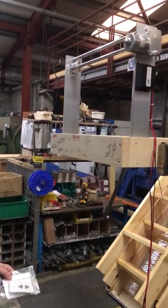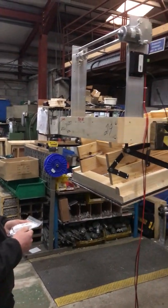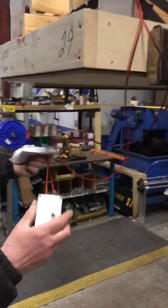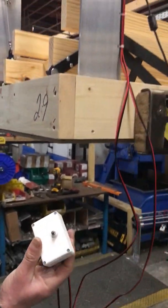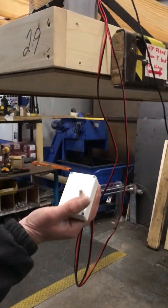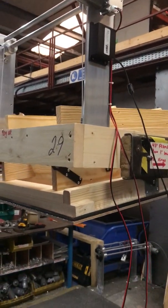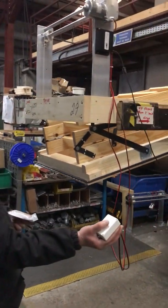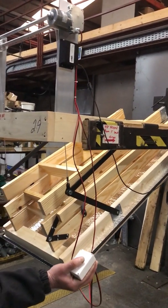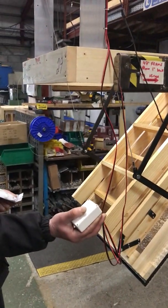And then one other thing we're just going to show you is the emergency hatch release button. So this is if you have a power cut or something in the house, which is this button here. It's normally located beside the Stira in your ceiling. It might be put somewhere in the hot press or anything. And the idea of this is when you press this button, it's a small battery drip feed which will release the hatch and open it up. So you can always get into your loft space even if you have a power cut. So that's if you needed to get to a water tank or something like that. And once you release that button, it just stops again.